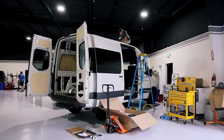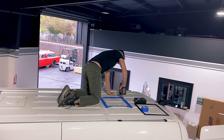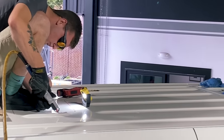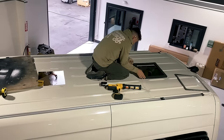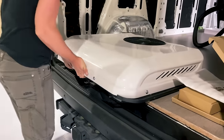The air conditioners we're typically using are in the neighborhood of 9,000 to 12,000 BTUs — not the most powerful, but given that a van is a small space, it will usually do the job if you have it well insulated and well ventilated to start. The overall installation isn't that big of a job — it takes the better part of a day. You have to cut a hole in the roof, mount the air conditioner, wire it up to power, and test it. Not the most difficult installation, but if you're not comfortable with it, you should definitely have a professional help you.